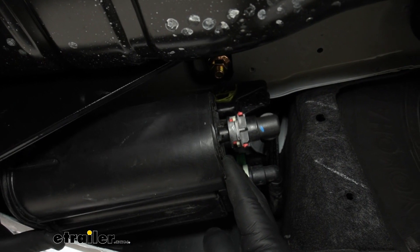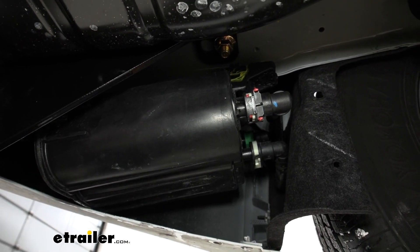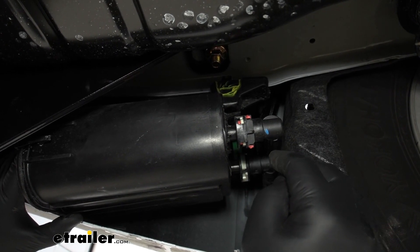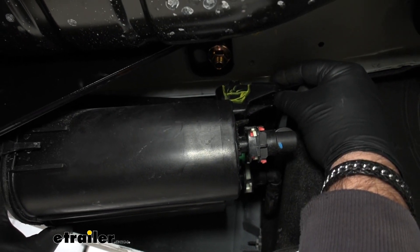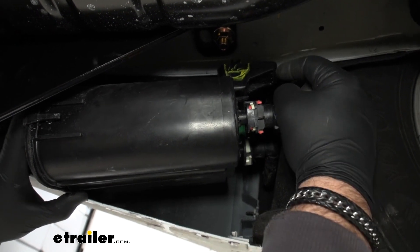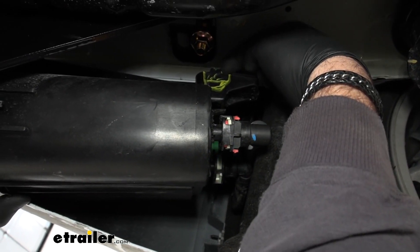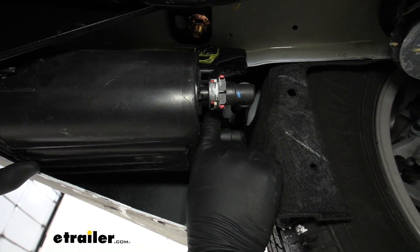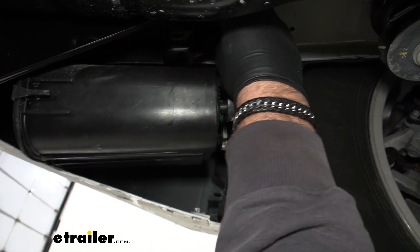The directions are going to tell you to use a long bolt from the kit to put your canister back in place, but they're not really clear on how to do it. We're finding it's hitting the factory bolt and we won't be able to get our bolt back in the front. So we're going to take this bracket off and modify it so we can get the canister put back in with both bolts. To take it off, use a 10 millimeter socket and wrench — the head of the bolt sits right up inside here and the bolt comes down on the nut side, with one on the back and one on the front. Once you get those off, take the bracket off and we can get it modified.